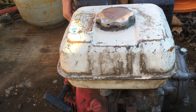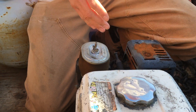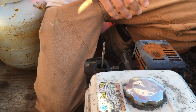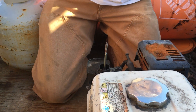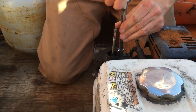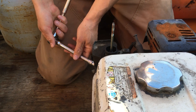I'm going to have to remove the intake now because there are a couple screws in the way and it's blocking access. There's the air filter, there's the seal. We're going to get this off as well — it's three 10 millimeter bolts that you just have to remove; you've got two on the side here.